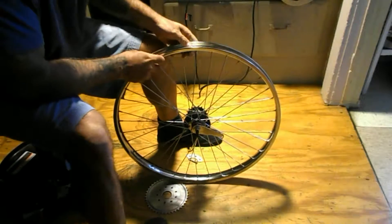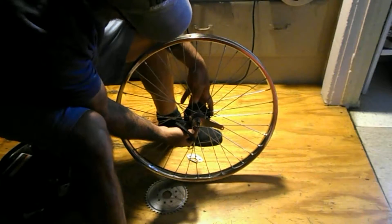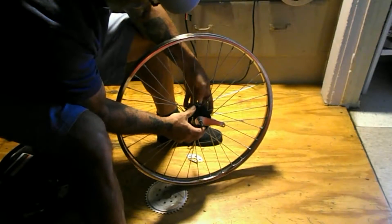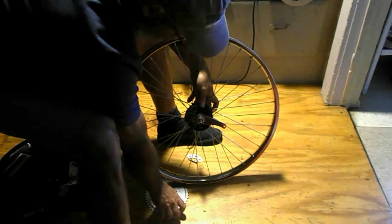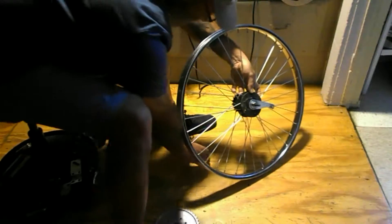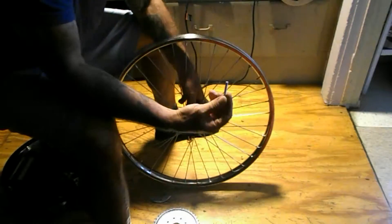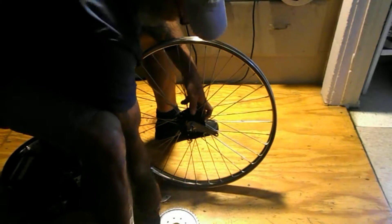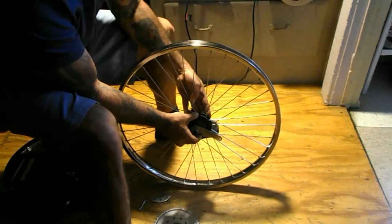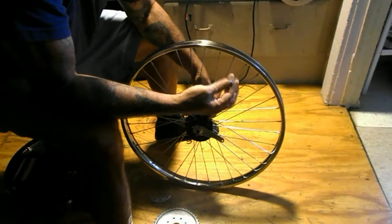The way you install this is you take the brake arm off first, put the cut rag joint on the inside and the solid rag joint on the outside, then you line up the two holes with each other. You put the gear on and line the holes up with the rag joints. There are three bolts — they go on the back — then you put the three-inch-and-three-quarter bolt through and tighten it all down to the specified torque. The Chinese version's torque spec is probably not even close to right.